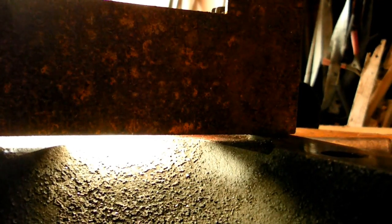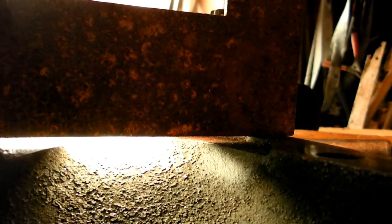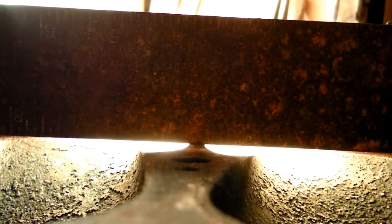We've got the cylinder head on the bench, and we've got a straight edge on it, and we're checking for flatness. Here's the problem — this is where she blew out, and there seems to be a low spot there where we can see the light through.